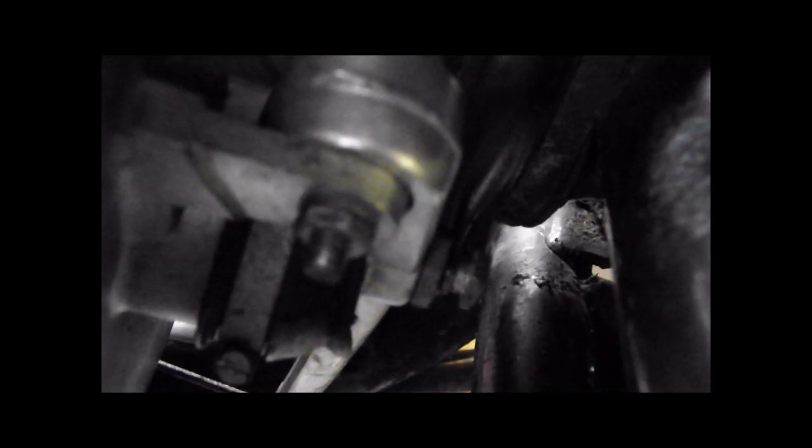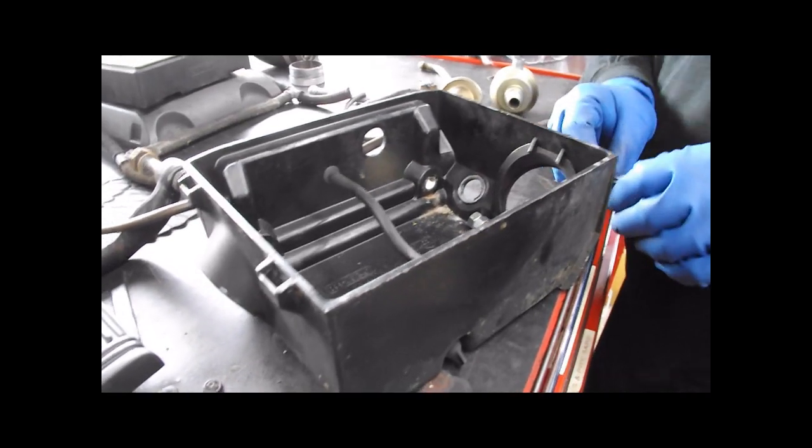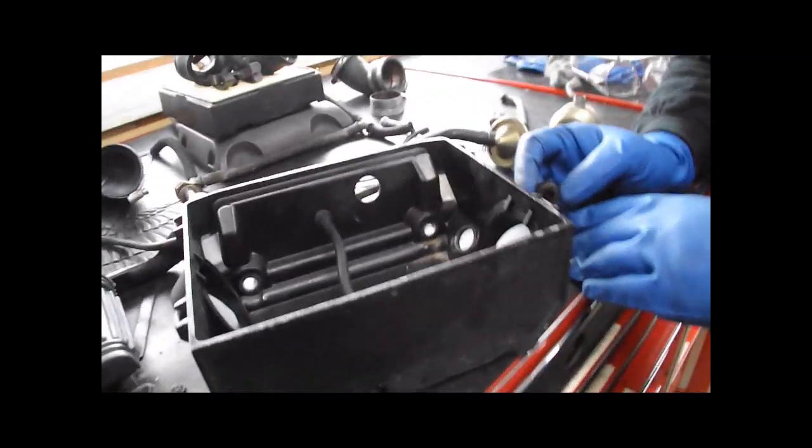Sean's going to pull that clutch in. That will lock the center pin into position so that you don't have to use 2 wrenches here. Now I'll take my 13mm and tighten it. And now we'll check it again. Free play is good. We're all set. You can install your airbox now.